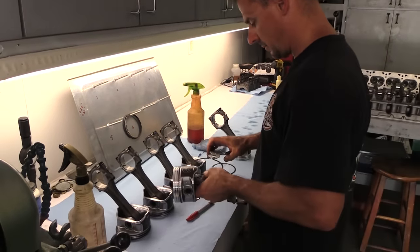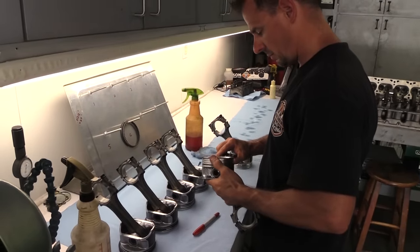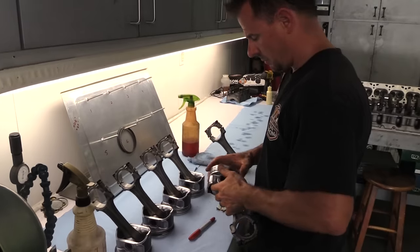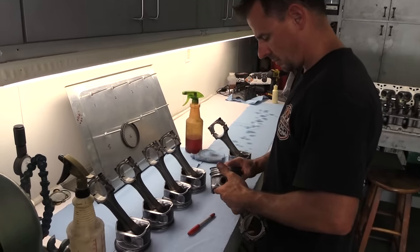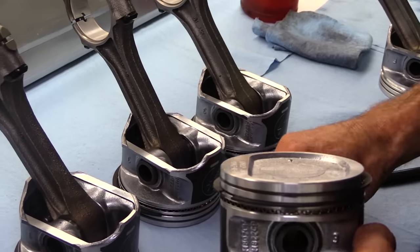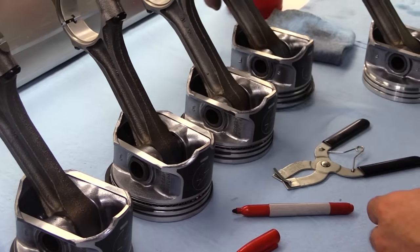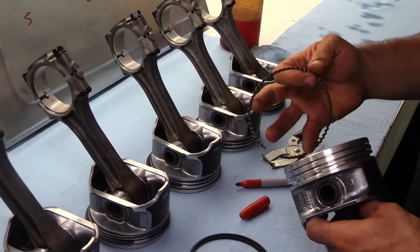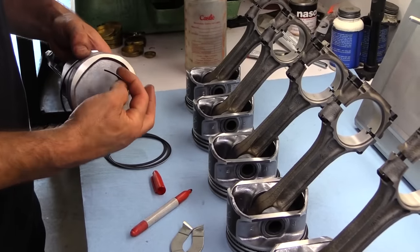The rotating assembly uses the same OEM connecting rods from a 4.2 liter engine. All 4.2 rods are 5.875 inches long, but they aren't all the same. The connecting rods from '71 through '81 engines are generally considered stronger. Those are the blocks with a 707 number in the casting code. '82 and up engines, those with casting code 352, are lighter weight and not as strong, so they're to be avoided if possible. Newcomer has also upgraded these rods with high-strength ARP through bolts.